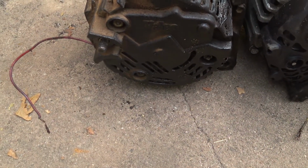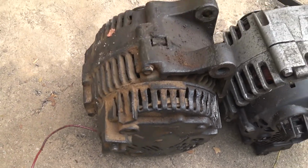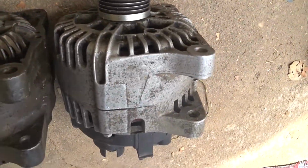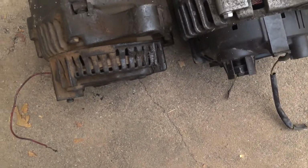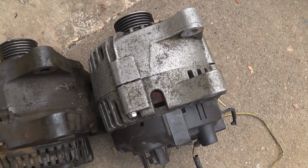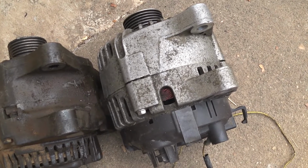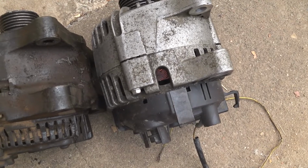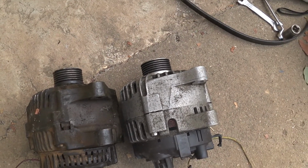From the look of things, it's also not for ES9J4S. I don't know which car it is meant for. So anyway, I'll start to mount this one, and probably will start the car without AC. Well, if it works, that's fine, but just to confirm the voltage. As long as I get 14 volts with or without AC, I'm okay. Alright, so we'll see.